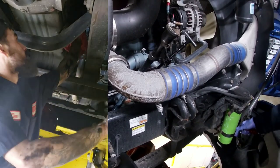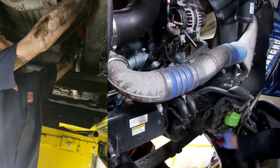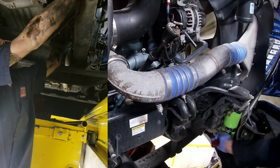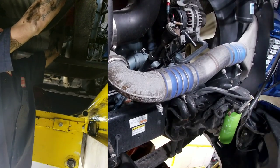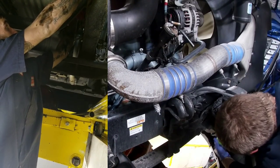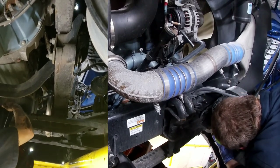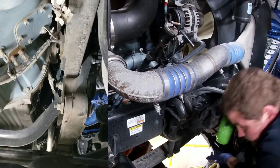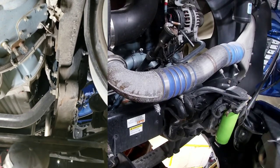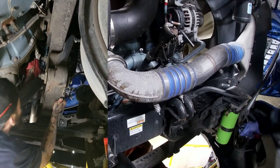Let's say you bought a vehicle that's prone to bad head gaskets. You see something like sodium and potassium. You see those two go together and go up a ton, if they're elevated, guess what? That's the sign of coolant in your oil. And you can tell from the very small, tiny particles in your oil before it turns into a milkshake. Once it's a milkshake, it's too late.